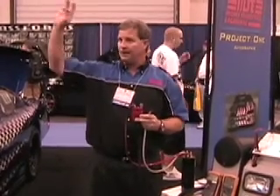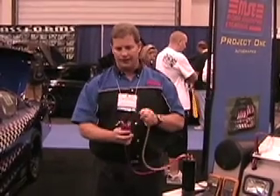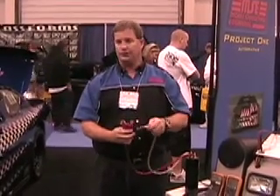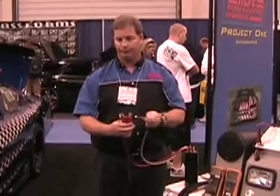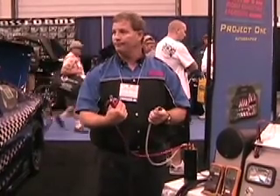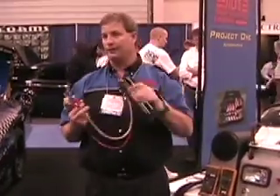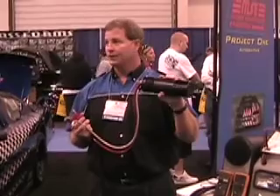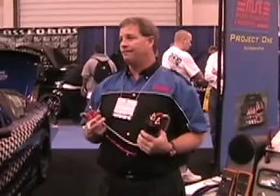Let's take a look at a fuse - it's a 50-amp fuse. Put that in there, charge the cap, discharge it through the fuse. That's a 50-amp fuse and we're not burning that fuse up. Any idea what the maximum discharge rate on the cap is across a dead short? It's over 500 amps - 500 amps through a 50-amp fuse.